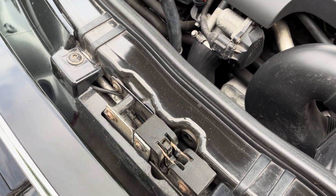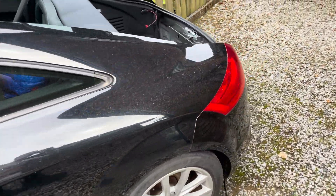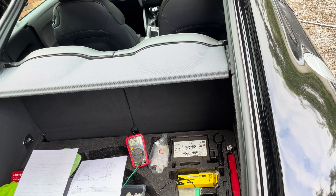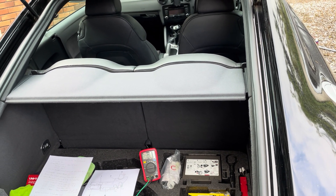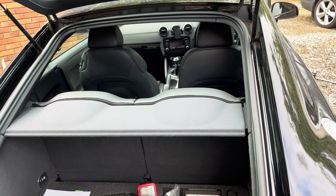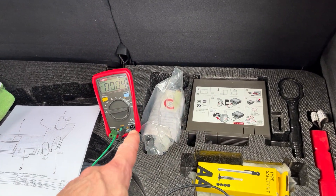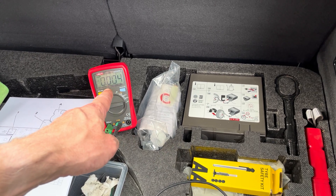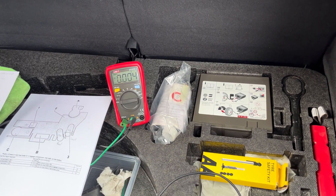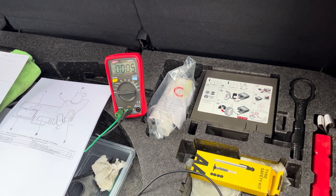There's also a switch on the bonnet — you can see the wire down inside here — so you may want to drop a screwdriver in there to put everything to sleep. Speaking of sleep, the car will draw current for quite some time after you've closed the door — as long as 10 to 15 minutes. The window controllers and BCM take a while to shut down. If you switch the supply off and on, it will start over an amp, drop to about 700 milliamps, then 200, then 140, and stay there for some time before dropping right down after about 15 minutes.